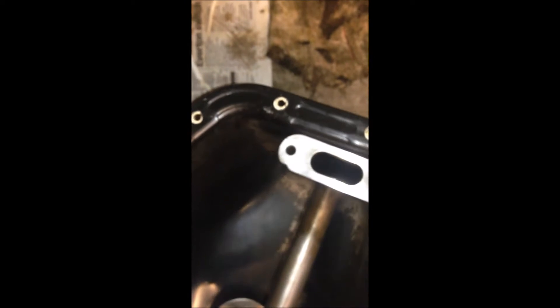When it's installed, we just let it rest. There is maybe less than one centimeter clearance from the strainer to the bottom. So if there's any sludge or mayonnaise, it is very easy for this strainer to become blocked.